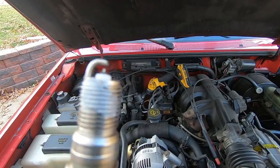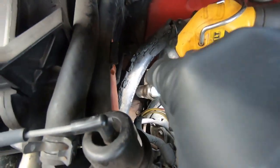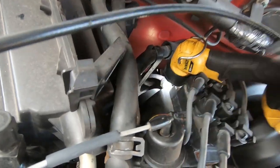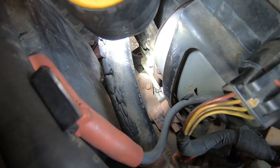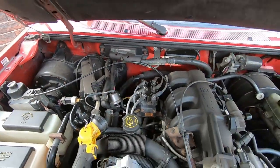Same deal as last time — just a hair of anti-seize, check the gap, this was at 55. I'm going to drop it in with my right hand and turn it once I get to the cylinder. I'm already in the hole, literally just dropping it in and finger tightening now. That's in — plug went in reverse with my right hand, drop it right in. Finger tightened it up, now drop the socket in and get a nice hand tight on there with the socket wrench. Got that locked in — barely tight, and that's good.